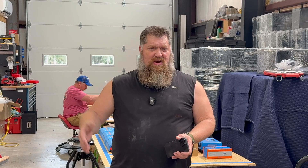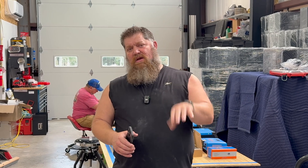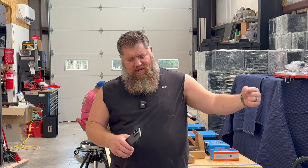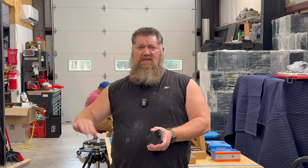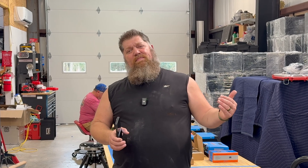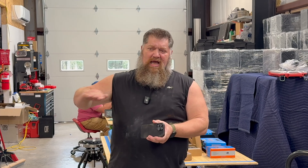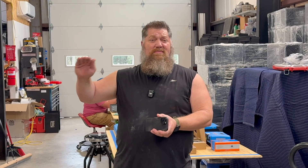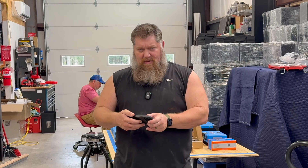Having a DC to DC charger helps do a couple of things. It helps regulate the power coming in, but it'll also step up the voltage as needed — taking whatever voltage comes from the alternator and delivering the right amount to the lithium battery. Lithium likes a set voltage; I recommend 14.2 volts as you're going down the road. For a faster charge, I don't want to charge the batteries all the way to full — get it close to full and then let absorption take over. Thanks, Meat Robot.